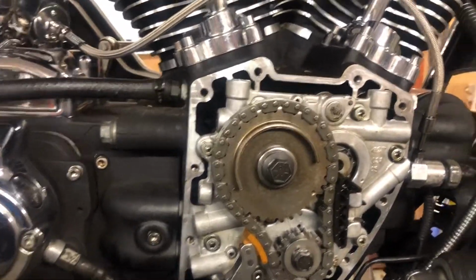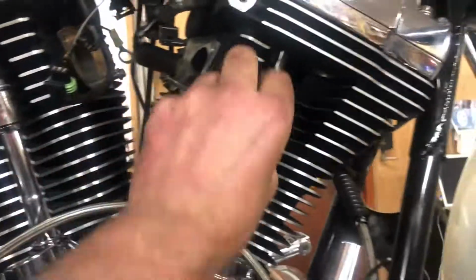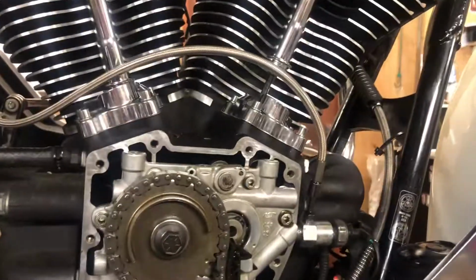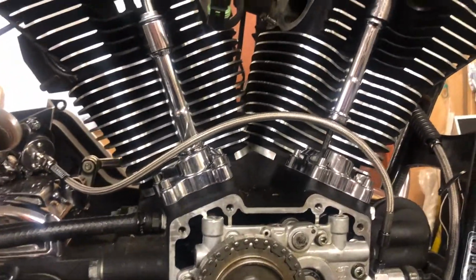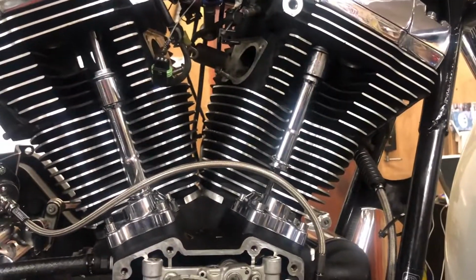Now, each of our followers has said it's 4 turns, so just now they're tight. Can't rotate them. So once they free up, you see we've got more little blobs of paint. That's just Tipp-Ex. So I just count the turns on the way around. So once it bleeds down, we'll come back to that and let you see them freeing up.